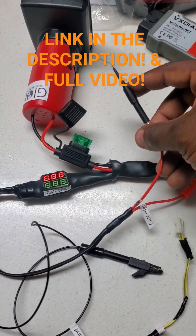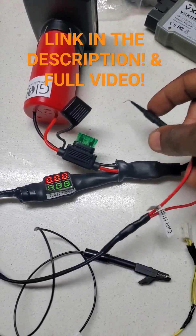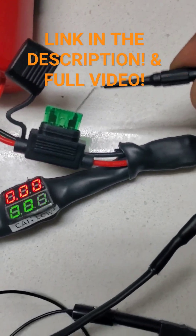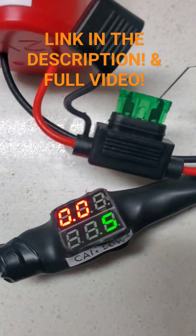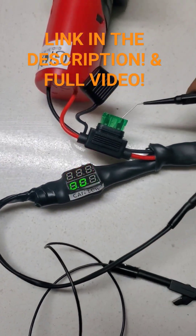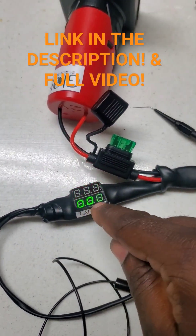Comes with these probes — colors will vary. I'm going to use the CAN low side and just hit the fuse. And as you can see, we've got 12.6 volts, and it's live. You get live data just like that. There's no flickering — that's just on the screen.